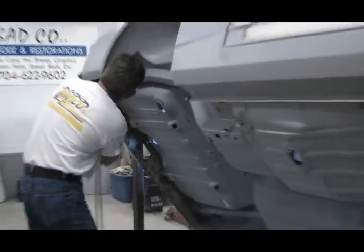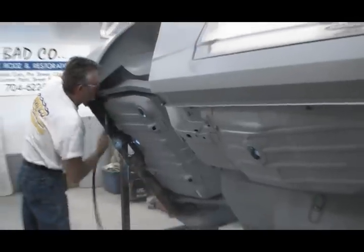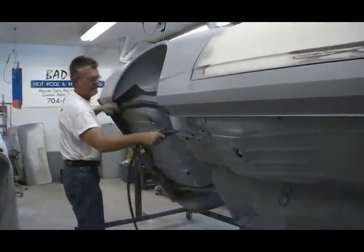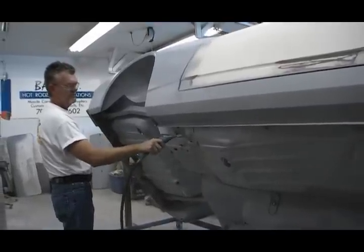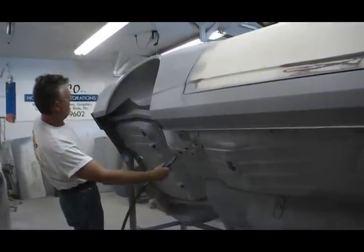Once that task is done, you'll need to make sure you clean off all of the dust. If you have sandblasted the car, dust and sand will be everywhere. So begin with an air hose before moving on to a tack cloth. Make sure to blow out the inside of the frame rails too. If you don't, air pressure from the paint gun can blow some of that stuff back out when you're applying the underbody coat and ruin your work.